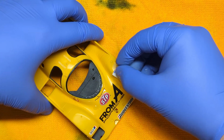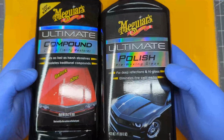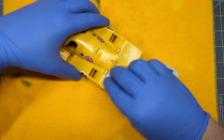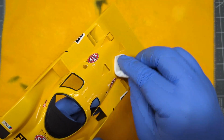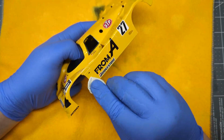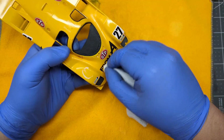After all the wet sanding was done, the car was looking really good. When I flatted it back, it was nice and uniform, but after polishing, some sort of dimples appeared. I wouldn't call it orange peel, although it does kind of look like that, so I'm not really sure what happened there. I have to assume there's some sort of underlying paint issue below the clear coat that no amount of wet sanding was going to reveal or repair, so it still looks okay from a few feet away, but up close, I'm not too pleased.